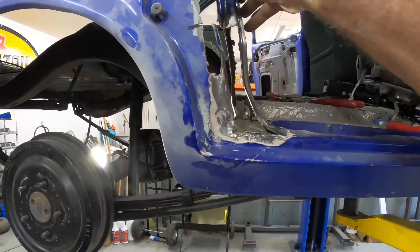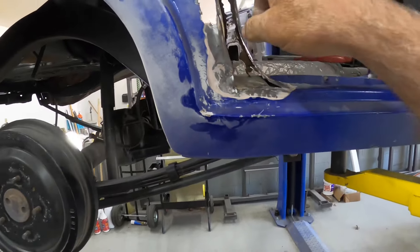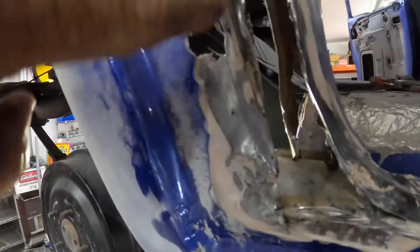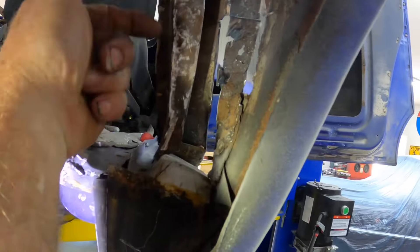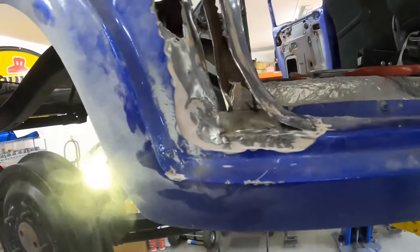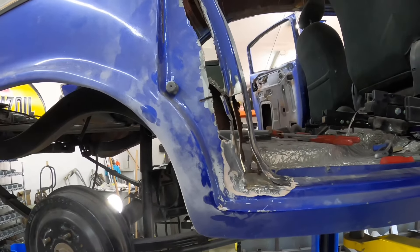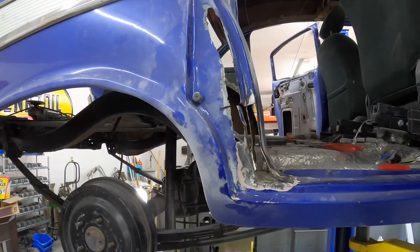Starting on this dog leg section - the inner on the inside here is rotted out. I've cut out this section here for this return. So I'm going to put a strip in here first, then cut this away and put a strip in here. There's a piece that goes all the way over to the new piece and turns a 45 around. I'm going to start with the outside piece and then the rusted out piece in here. You can buy these outside panels - they're all one piece. But it's Memorial Day and I wouldn't get it delivered until end of the week. For this small section I can make it - save money.